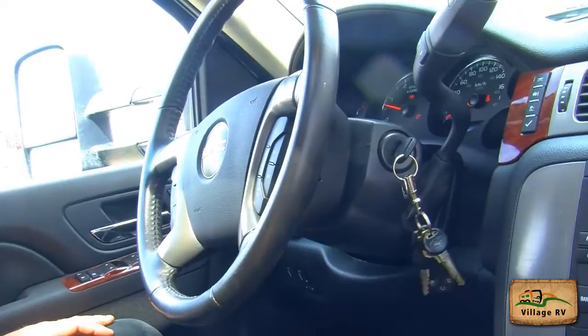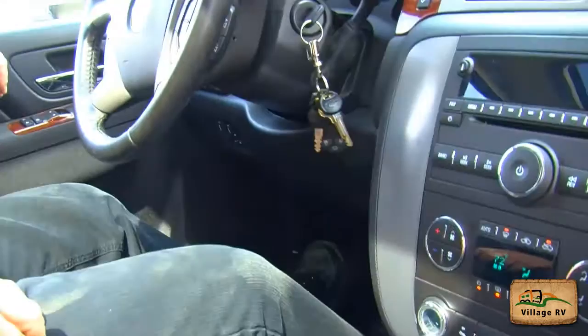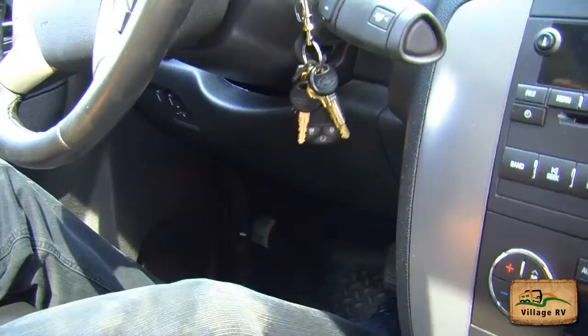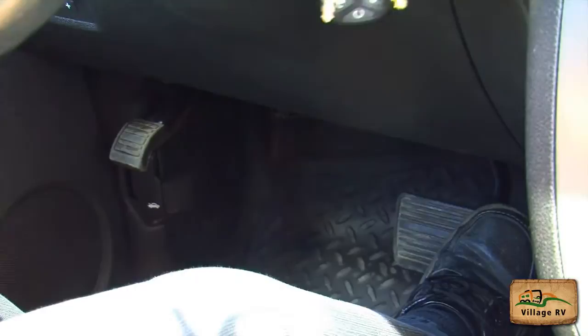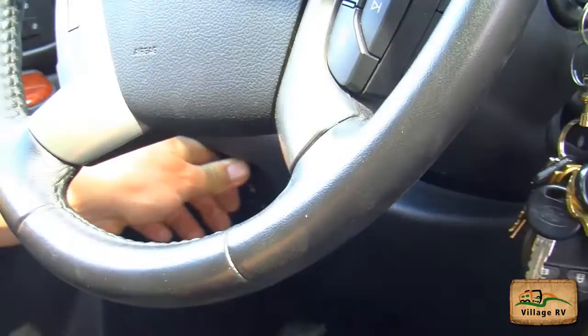Now we're going to do four brake tests. Prior to leaving and putting the truck into gear, you must put your seat belt on. My emergency brake is already applied. For the first brake test, put the truck into gear and attempt to pull forward — step on the gas a little bit. My park brakes are working. Then release the park brakes. For the second test, with the brake controller for the trailer on the left-hand bottom side, pinch it together, step on the brake, and try to go forward — it's working. For the third test, I idle the truck forward, apply the truck brakes, and the brakes are holding.